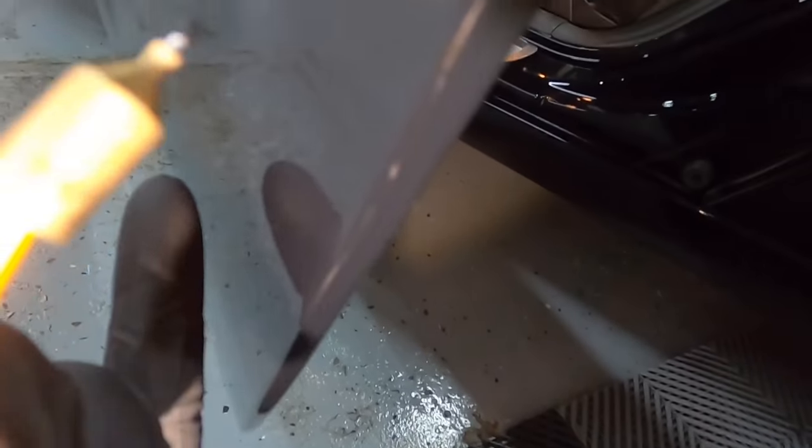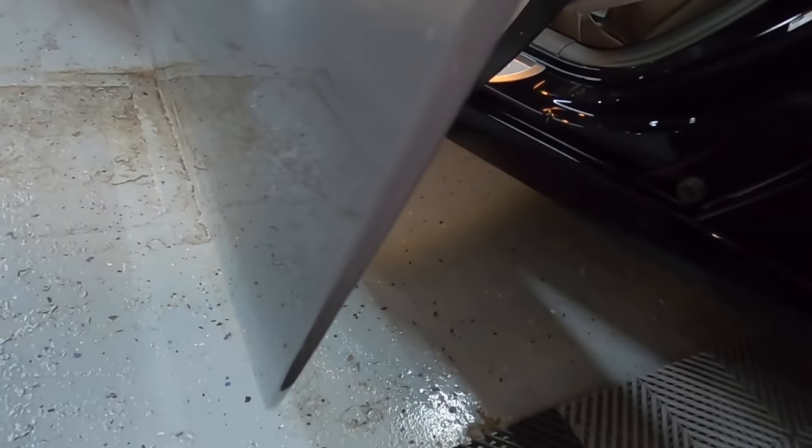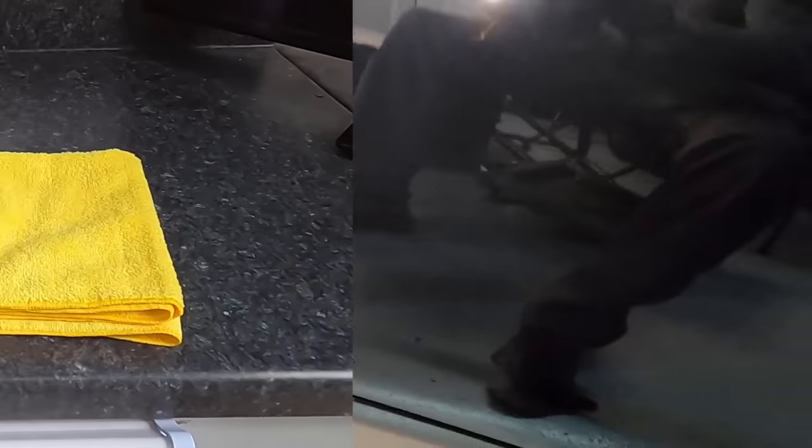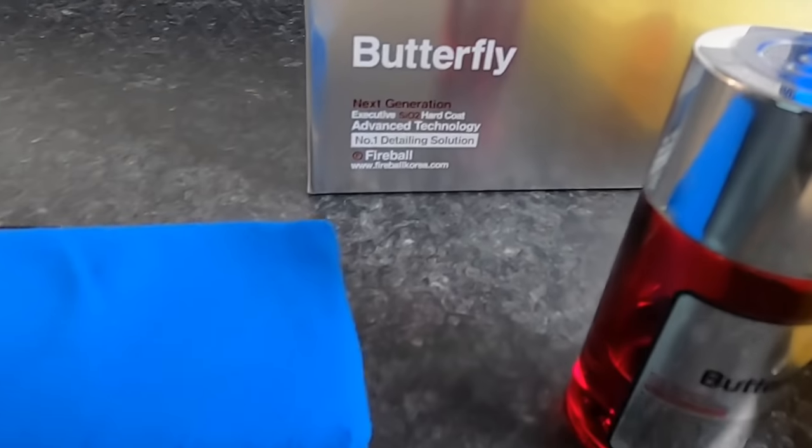And using a little common sense, to do them right, you really need a couple days to fill them in with the OEM perfect match paint. And then let them cure for a couple days so when you start working on them and wet sanding them, they don't pull back out from the chip itself. So just keep it simple. Fill them in, protect, and move on.